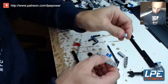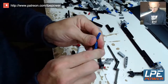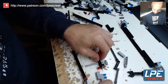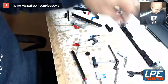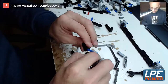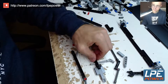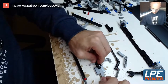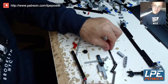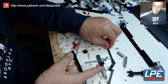One of them involves us doing this. So we would have our steering A-arm done like this. Not my favorite solution, of course, because it's not going to be modular or removable, because now I'm basically fixating it to the suspension bridge. It's semi immovable, but I still want to triangulate it to the back. However, this gives me the freedom of having the anti-roll bar here.